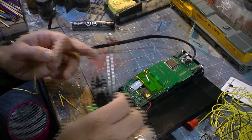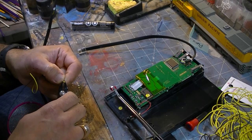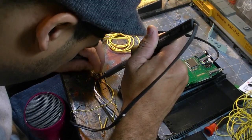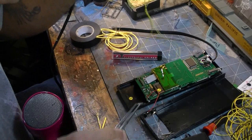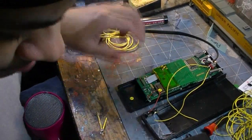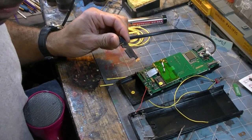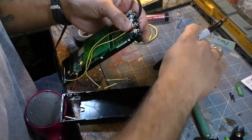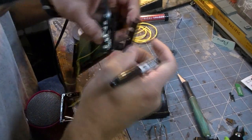Here's my setup right here. This is the toggle switch. I just put the pliers onto it as a heat sink because I'm about to solder these lines to them. That's done. What I've also done is removed the gray wire because this is going to take the place of the gray wire. I'll show you where the LED is going to go. I have to remove this to burrow a hole into it. It's really easy to carve it out. I see where it's going to go — right in there.